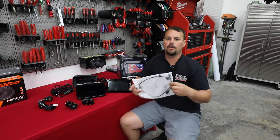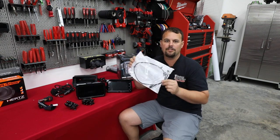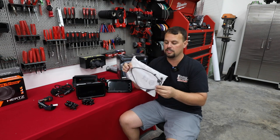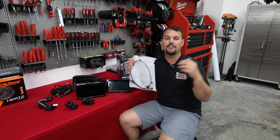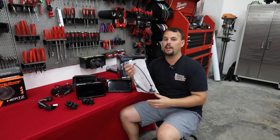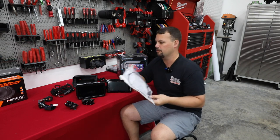Our new radio, whether you go with a factory radio or the Soundstream Reserve radio, is gonna require a factory style USB. This is not gonna be in the bike. It doesn't come in the police version. We buy them from Harley. They're available on our website. There's a Road Glide version, a Street Glide version, different links. Street Glide has been hard to get. So if the Street Glide one's unavailable, buy the Road Glide one. It's longer and it will fit the Street Glide fairing as well.